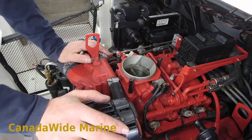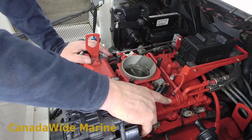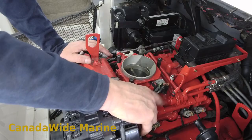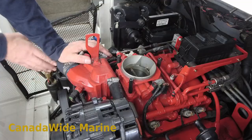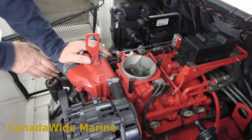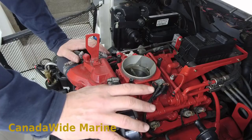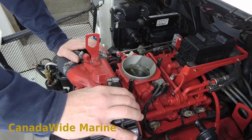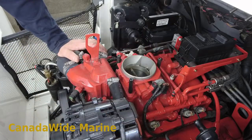To summarize: if the return screen in your regulator is restricted for whatever reason — whether it's fine dust like this one, or the black paint from the pump — that can cause a fuel pump whine from these Volvo Penta motors. This one just had some fine dust in it and was not whining yet, but if left a couple more years with that sort of build-up, it probably would start. So as preventative maintenance, just clean that filter out and that'll help your Volvo Penta fuel pump last a whole lot longer without any noise. Thanks for joining me.